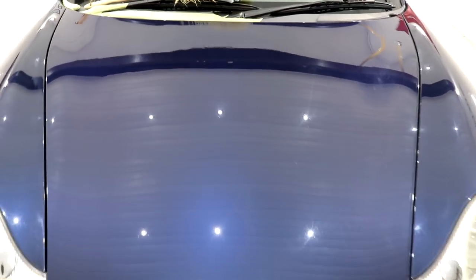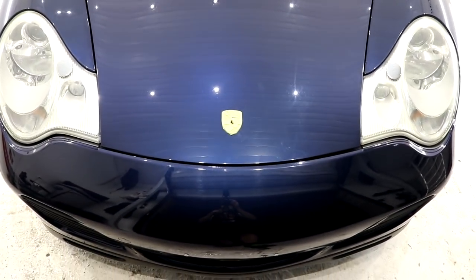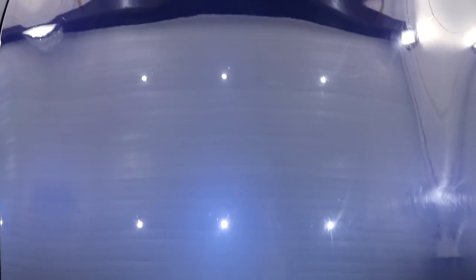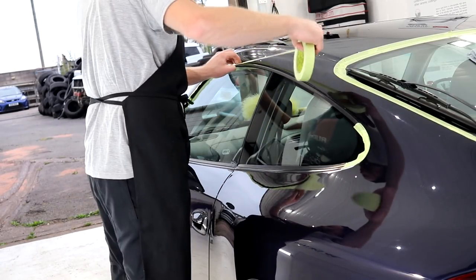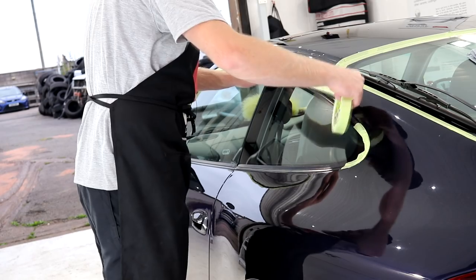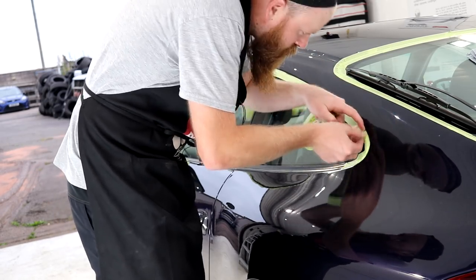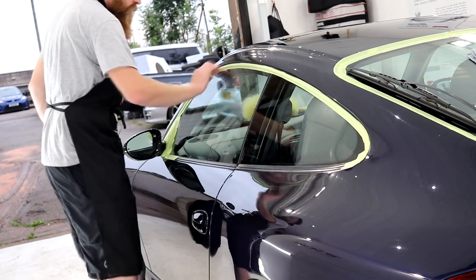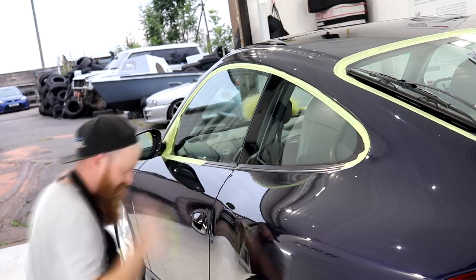I'm pretty good nowadays at determining what level of finishing would be required depending on how the compounding finish is looking, so I simply eye it up with my very own eyes and come to my own conclusion. Those polish oils and residue that would be removed with IPA are only going to be masking a few self-induced compounding marks and holograms. The oils and residue are not going to be masking the original swirl marks or scratches, so I don't generally IPA wipe down whilst doing the compounding stage.